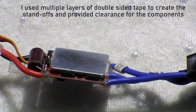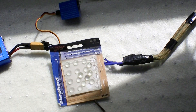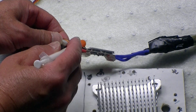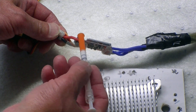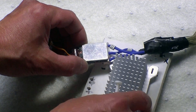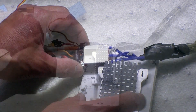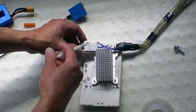You can also try to use something like this. Because of this capacitor which is above the heat plate, I have to place this device sideways so it fits underneath here, and the capacitor will be showing here. This is thermal grease, so I'm going to spread the thermal grease onto the surface.